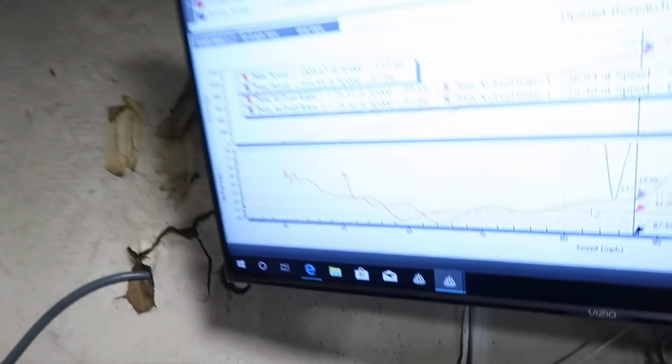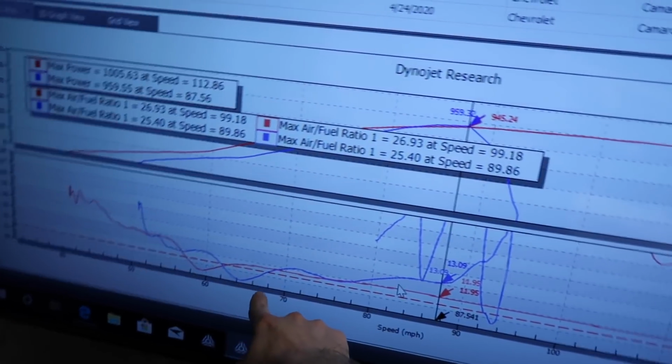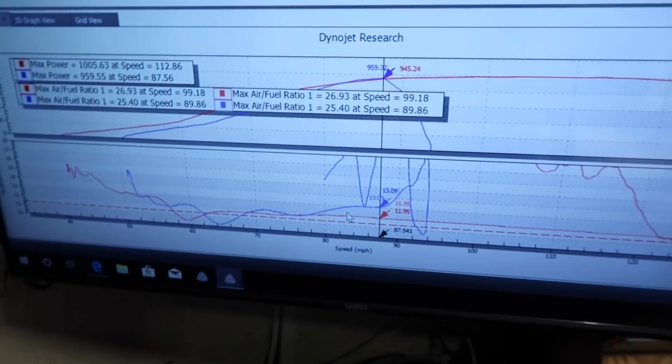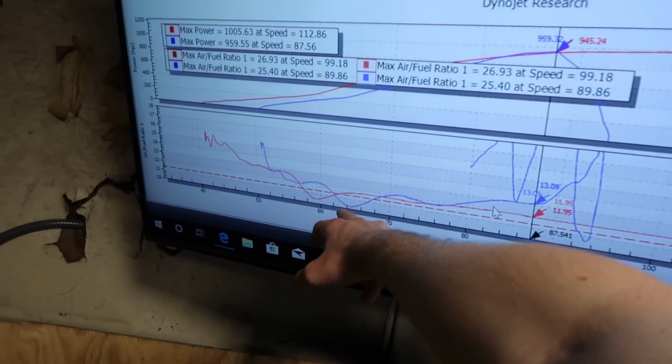No, I mean, it's kind of a sense of relief because we have a log on it now. Yeah. And we have air fuel to go along with it. Look how deep it dove there. It's almost 10. Was I supposed to watch that with my eyes and see the air fuel dip? It'll let you know. It's almost 10.0 right there. Then it comes up.